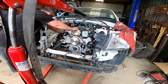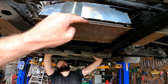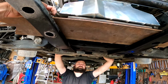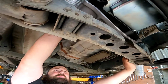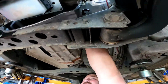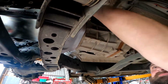Where they mate. We're 30 mils low here. So this should be up 30 and technically about 20 mils over. But it doesn't matter if we don't get that too much, because we've got plenty of room here. We've got no room here. Ah, right. So if we move it over 10 mil and then gave this a bit of a... Yep, so that's going to give us that.